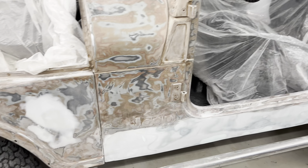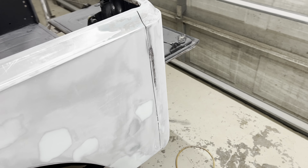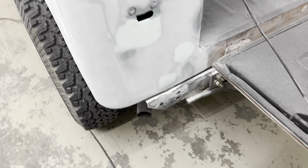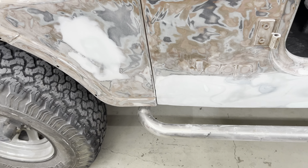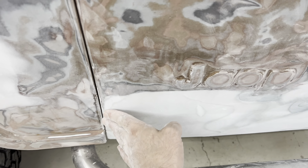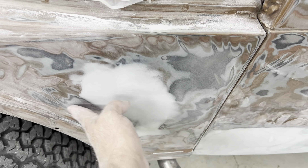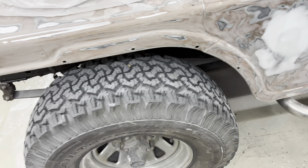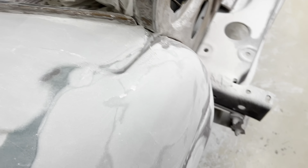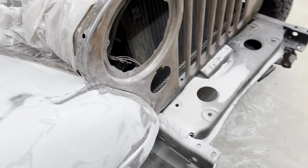All right, I've got all this sanded to 120 — these glazed areas — so it's relatively smooth now. There are a couple of places that I can already tell are going to need some attention after I 2K prime. One is right in here; the field's got a little bit of waviness to it, somewhat, not too bad. And here I think this area is a little bit low. So I'm going to prime it anyway and block sand it. I did some sculpting and contouring of this front fender and it's looking pretty good.